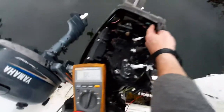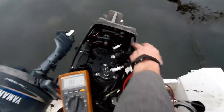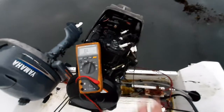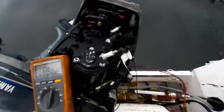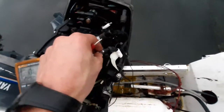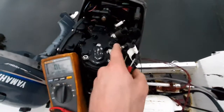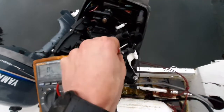For this engine, I checked all three coils and found readings of 8.96 and about 8.5 for two of them, but the third one was around 200 kilo-ohms — so I knew the top coil was the issue. After a little investigation, I found that the top of the lead cap was damaged and that's where it was arcing and losing its power, so I simply cut it off.